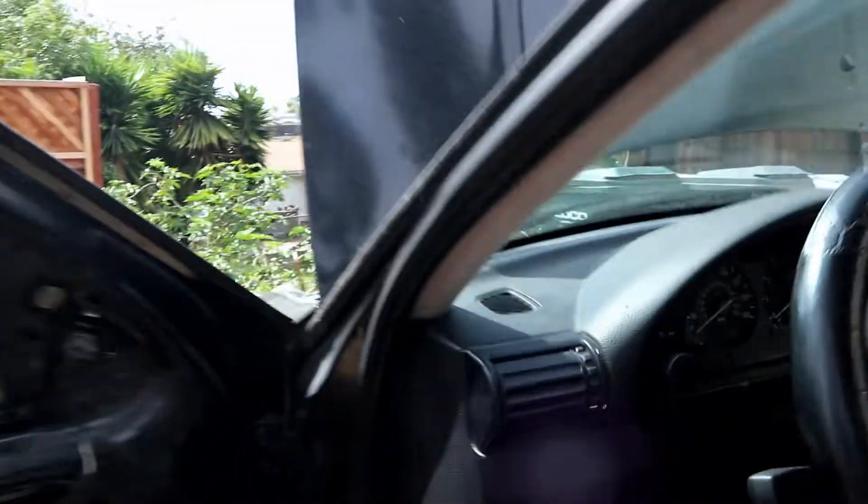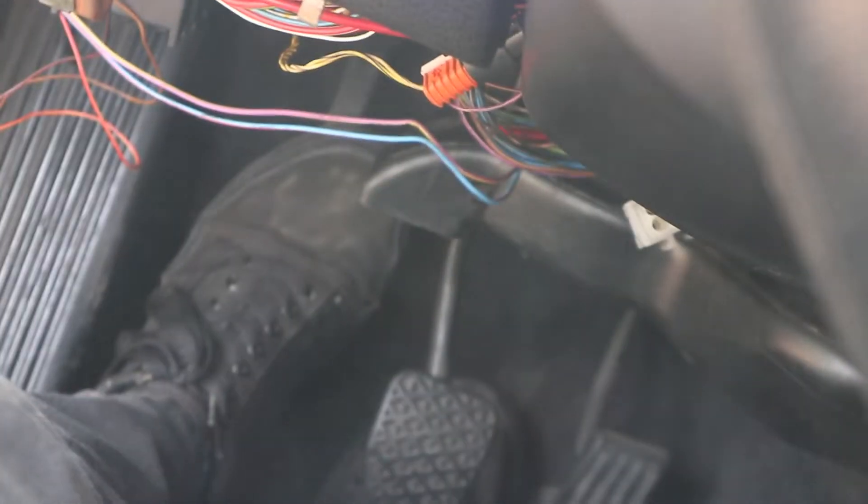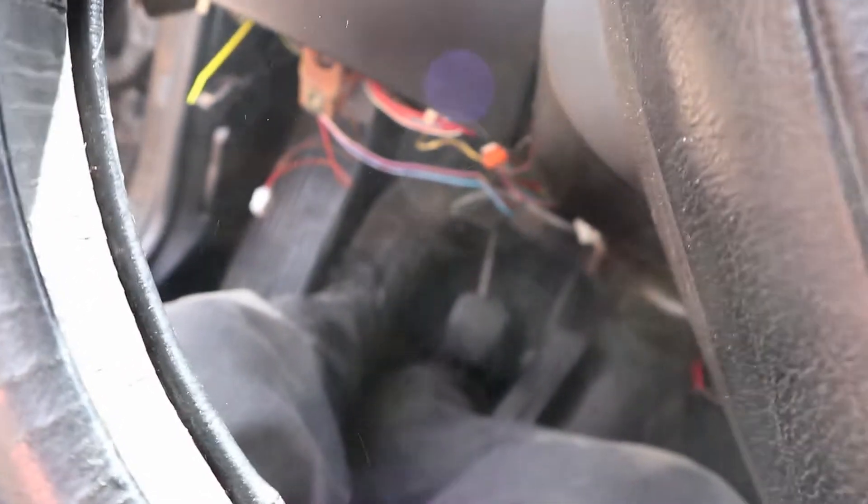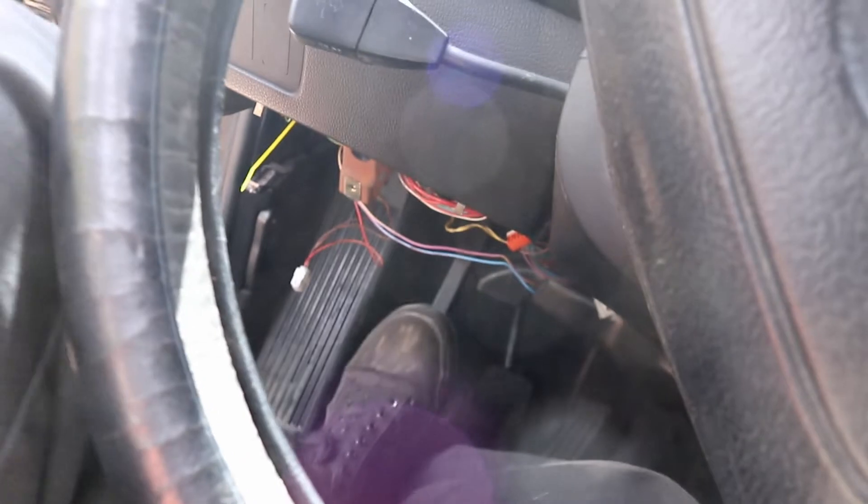I accidentally got the rubber piece out so it might make a light, but as long as it doesn't make noise we'll be fine. In literally three strokes it went from no pressure to solid pressure — immediately. We got just spewing fluid. We bled it for literally an hour and a half before and got nothing, and that's literally the second pump — the master was shot.